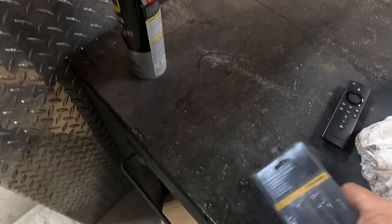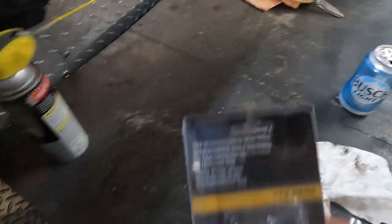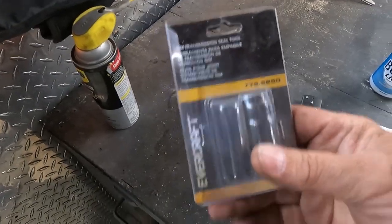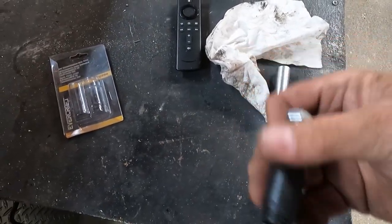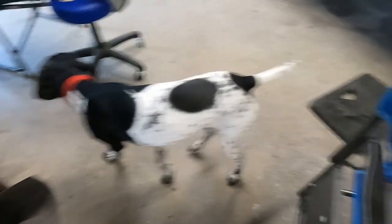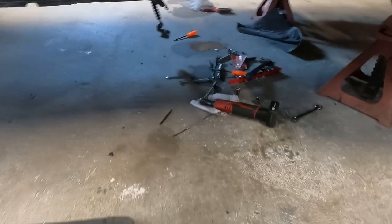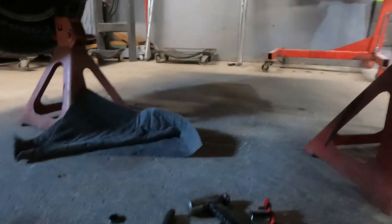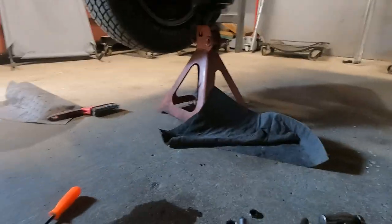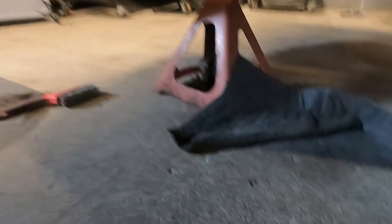So I got this little tool here. It's a GM transmission seal tool. I got a little lubrication to help. This is a 776-9250 and you're supposed to be able to just screw this into the shift shaft seal and pull it out. That's where all this bloodletting is taking place — we finally figured out. Thought maybe we had a line going bad or some crap like that, but see, look at that mess.